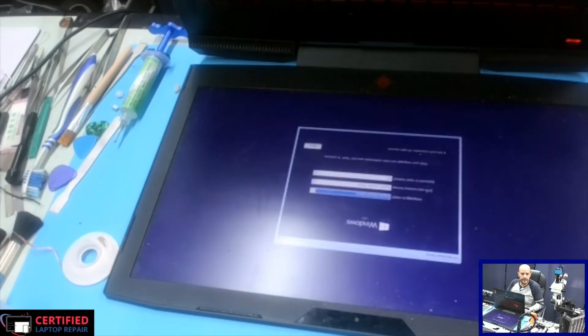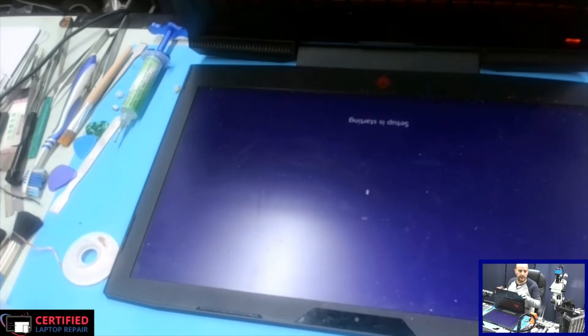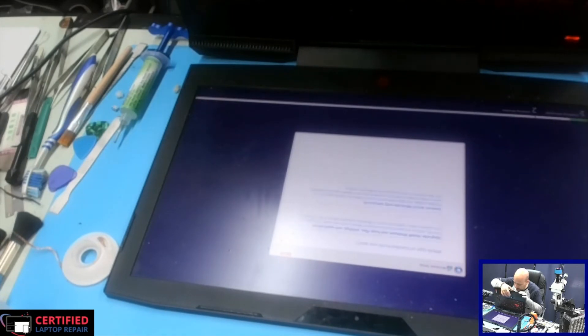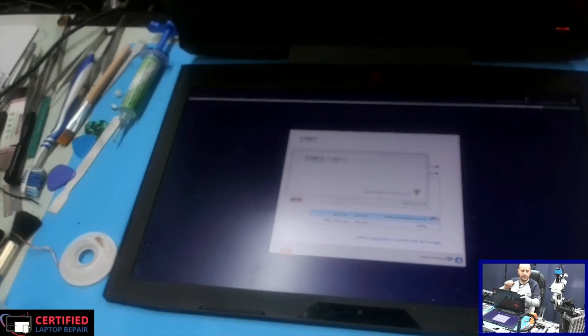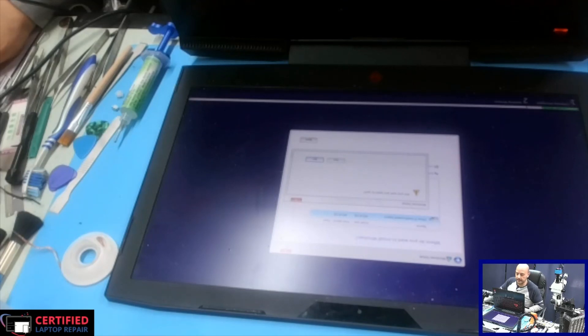As you can see, it's booting from the recovery media. Let's go next — install now — and we're going to make sure it's detecting the hard drive. We can do it this way or check from the BIOS, but either way is fine. I usually like this way better. And here you go — I got that 500 gig hard drive detected. We can repartition it to install Windows on it, so it's reading the hard drive. Problem solved. All I need to do is hold this connection back in place, put the computer back together, and we should be good to go. Thanks for watching — I hope you liked the video, don't forget to like and subscribe, and I'll see you in the next one.